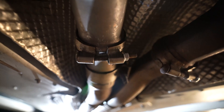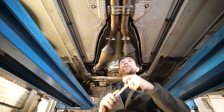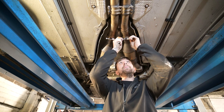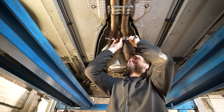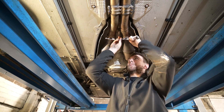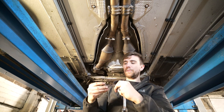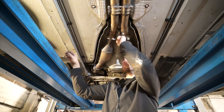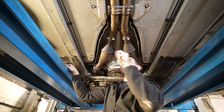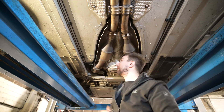Towards the rear you're going to have some joints — remove them with one nut, slack the bracket and slide it back. All of these bolts are 13mm, so you just need one 13mm spanner to remove them fully. Place them off to one side, then prise the parts apart and slide them back onto the pipework just behind.